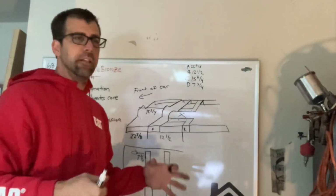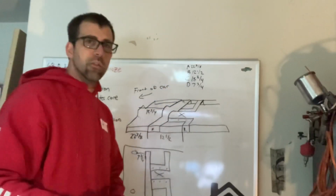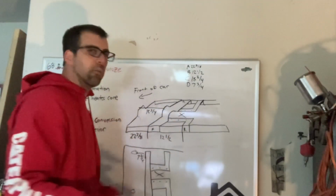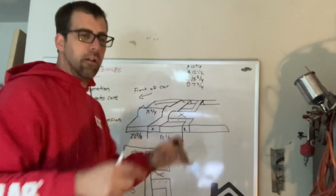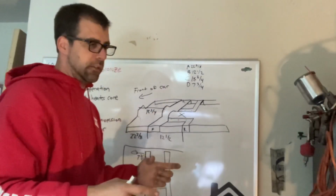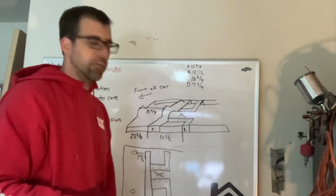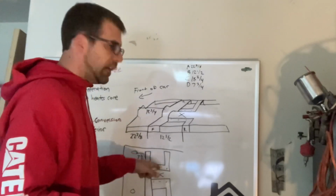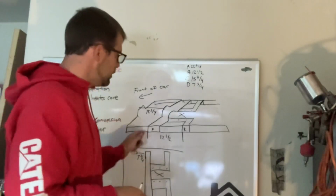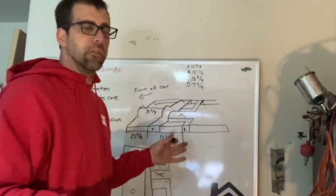And the last step, if tackling this job, installing all new bracing, which is 3 pieces, 1, 2, 3, attaching it to a new floor pan, there's an X brace that bolts to the center of this. Kind of illustrated here and here. There's 6 bolts. I would recommend putting that panel on, loosely, allowing that panel to float as you attach all the bracing to the floor pan, because in the end, all these numbers are dead on. If that brace is shifted a little bit and you can't get the bolts through, well, it's not going to do you any good. So leave the bolts loose though, get everything set into place, then weld it. So use these measurements, put that X brace on, and you should have really good results installing this floor pan yourself in the garage.